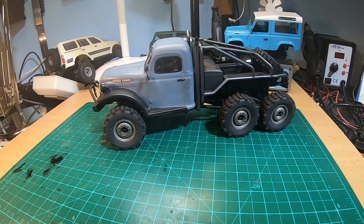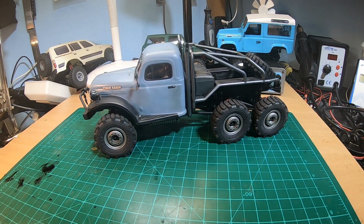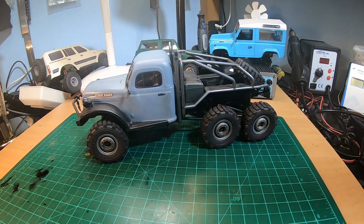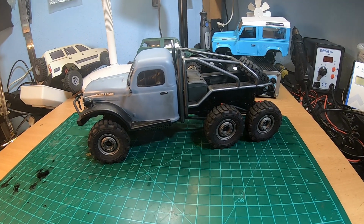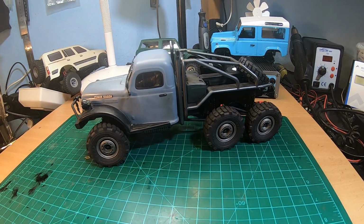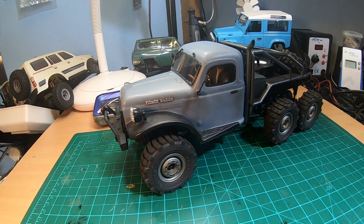it will not be possible or very difficult because there are those pins that are needed for the steering cup. I found it's not that difficult. It was quite easy to do. You do not need heat. You can't use heat anyway to get the pins out or to remove some glue, because there is the plastic gear sitting on the axle shaft.